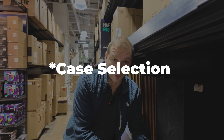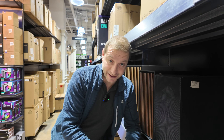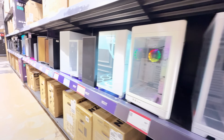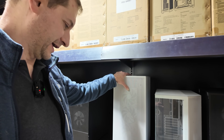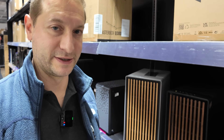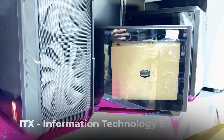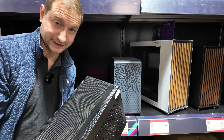Typically when shopping for a computer build, you go with a CPU, motherboard, RAM, and things like that. But since my highest priority is space, I'm starting out with a case. This one's kind of nice but it's a little bit too big—I want to go even smaller. These larger cases are called ATX, for Advanced Technology Extended. They come in huge ATX towers, then smaller ATX sizes, then micro ATX—which is the size I'm getting. There's also mini ITX, which stands for Information Technology Extended. They're even smaller cases with a lot less upgradability and space.